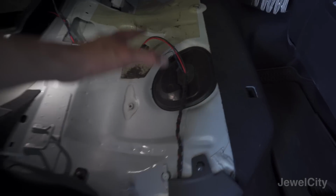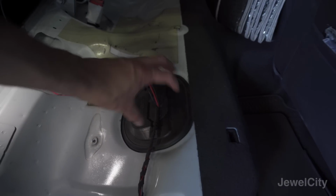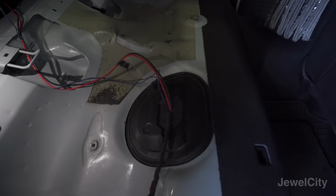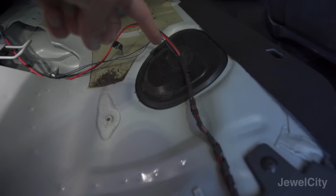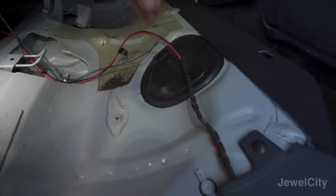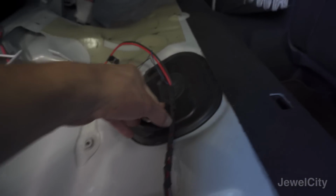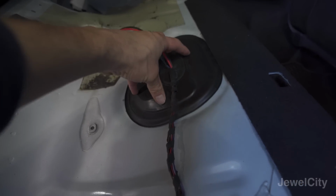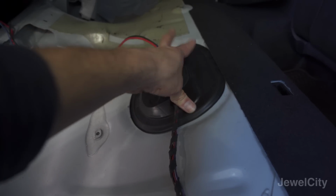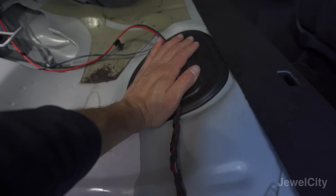Anyways, in your GTI, you've got a low pressure fuel pump. This is basically where it's located. You take out the back seat, you pop this off, right? And then you unscrew the cap on the top, and inside you'll have your fuel pump. Now you'll have your fuel pump basket, as well as the actual pump itself that's mounted inside the basket. So basically what you'll need to do is upgrade that fuel pump that is mounted inside the basket. Put the basket back in. Again, this video is for those of you who are still pretty new to this stuff.